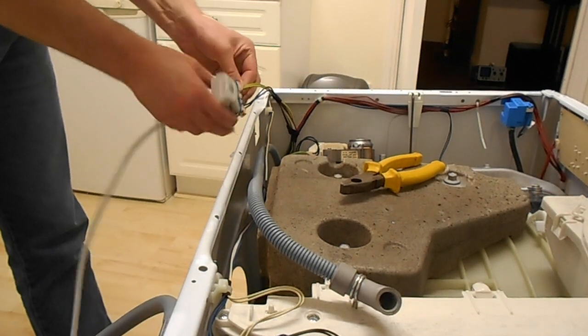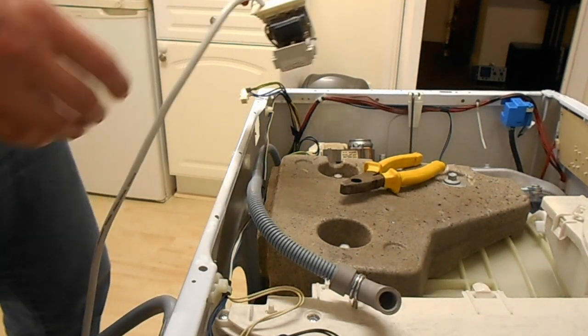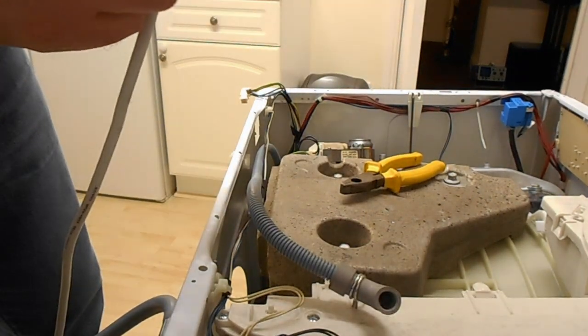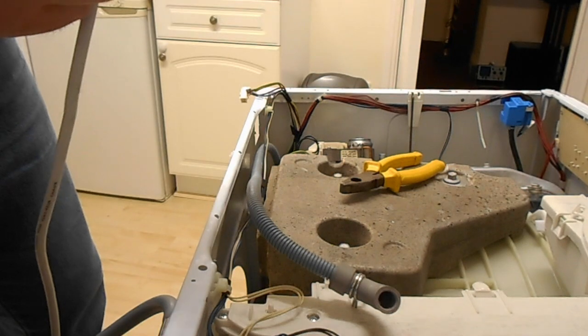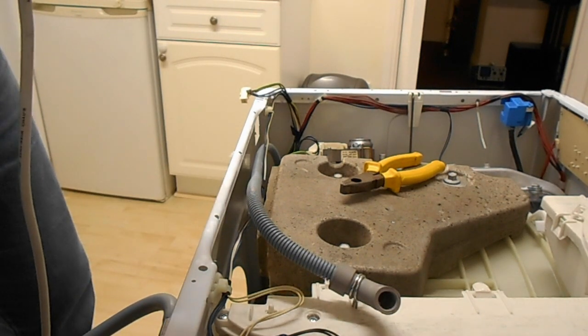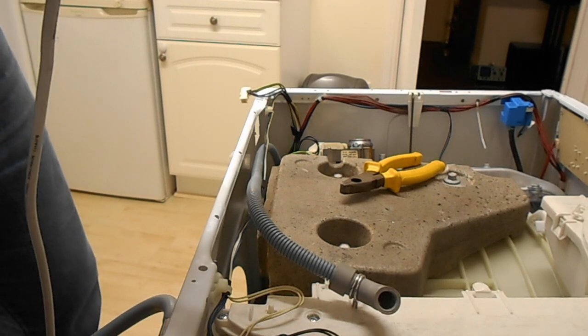If you've noticed, this is just a mains filter. Is this on the camera? So there's a little toroid in there. There's some across-the-line caps. One, two. Post filter there's a little resistor in there to discharge them.